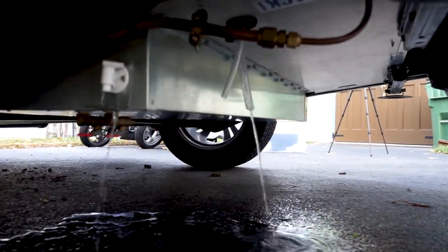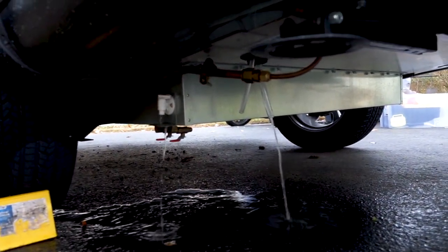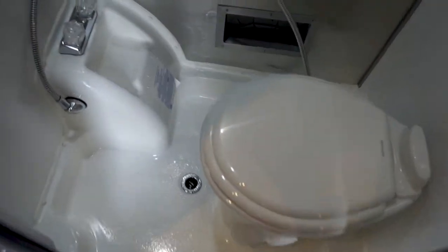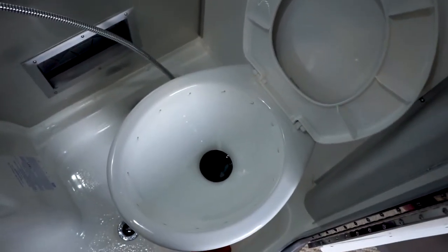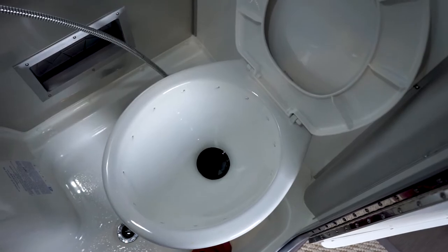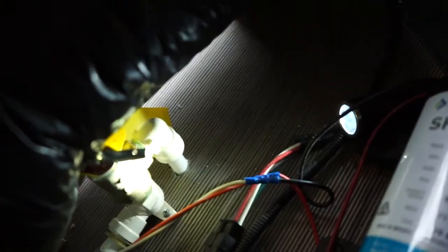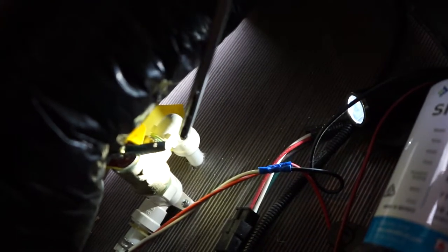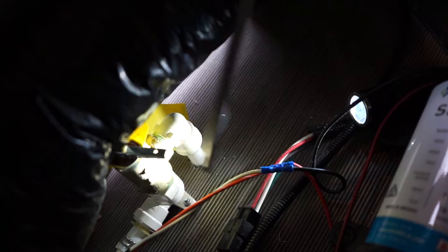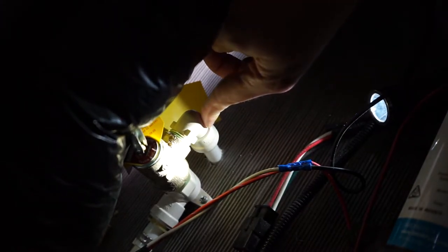Wait until all the water from these valves has completely drained out. While everything is draining, come back into the Base Camp and do a couple other things. Come to the toilet — make sure you exercise this valve and let any excess water drain out. Another area to look at is down in the mechanicals area, to the left of your water pump: you have your hot water tank's pressure release valve. There's a little valve on top of it — you want to lift that valve up to exercise it, and also to drain any water stuck in this pipe. Make sure that it is back in the down position after you're done.